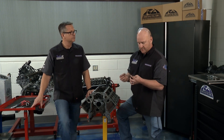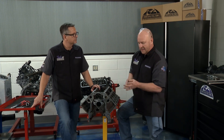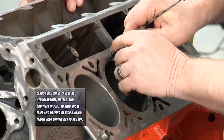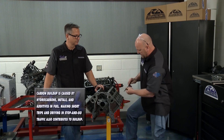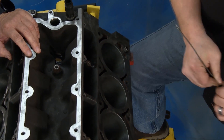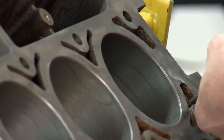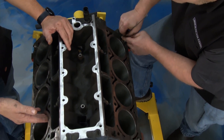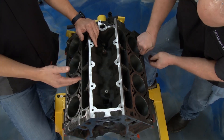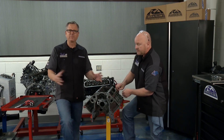If you've ever cleaned out a rifle or shotgun barrel, you've seen a brush that looks very similar to this. I'm going through every single cooling passage, every oil passage, every threaded hole, making sure we've got no contamination in there, no grit or grime left. This is a little methodical — it takes time. Clean the brush after every stroke, and work all the way through. These are the cooling jackets right here — that's critical because we're probably going to run this thing pretty hard. The coolant passages go right by the cylinder. If something's overheating there, you may have a lean condition. And he's passing through the oil passages — there's no way for the oil to return or get to the different components without going through the oil galleries. We highly recommend sending it to a machine shop to have all that done.